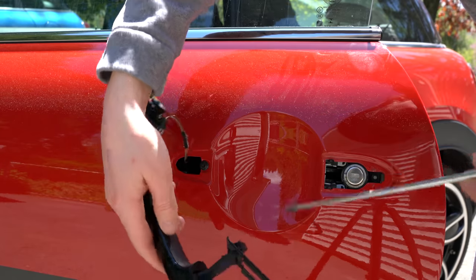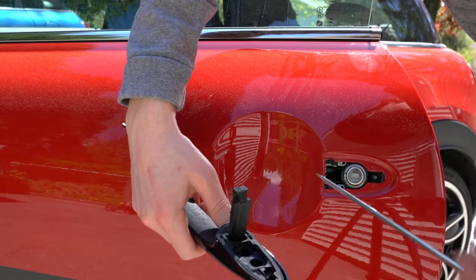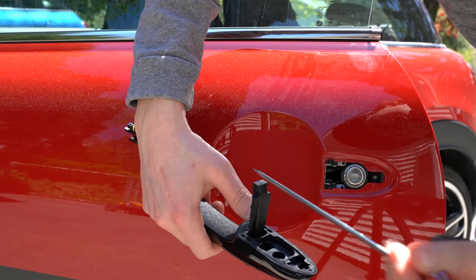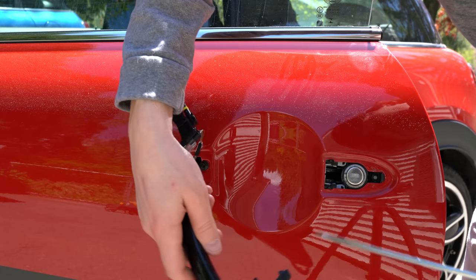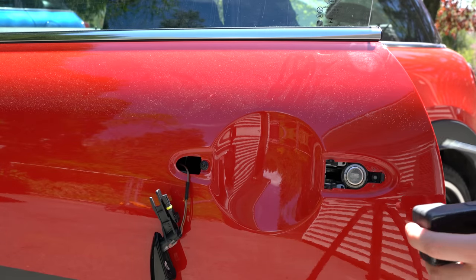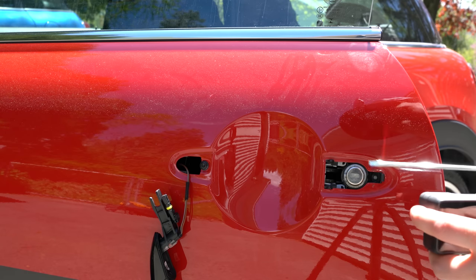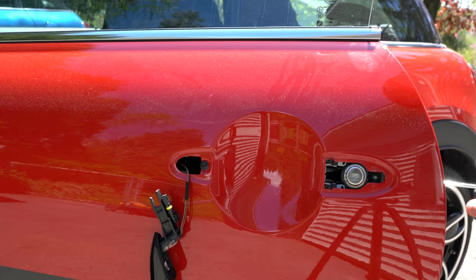There's a pivot point — a little barb — you've got to get into the front, and back here this T grabs that latch pull and pulls on the latch. So we've got to pull that latch out because it's under tension, hold it out, slide this T into the latch, and at the same time slide our pivot point into the bar in there. It's a little easier on the passenger side because you can stick a screwdriver into the hole where you unscrew the latch and pry up the latch catch, hold it there, and then slide the heel of the door handle into it.